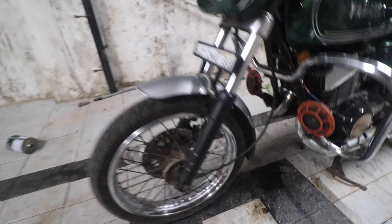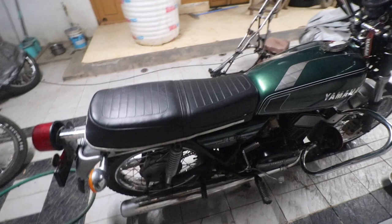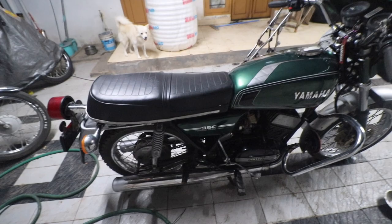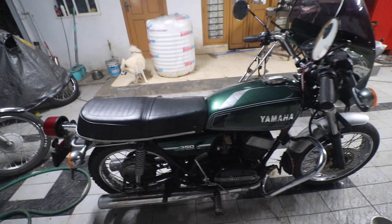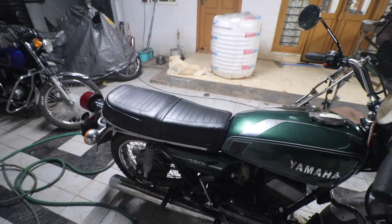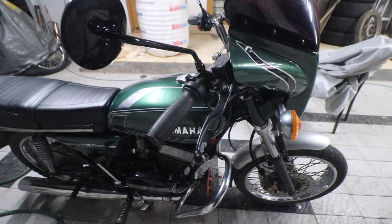Another big challenge with the drums, especially the rears, was the availability of brake shoes. The ones you get these days are made in Delhi and are not the exact shape as what came from the factory — I kept two for comparison and found the shape was not identical. Another challenge is these drums get warped; they're not cylindrical anymore, they're kind of oval. So even if you put a new brake shoe it won't stop, or it might get stuck. It required a lot of calibration to get to where this bike stops amazingly with very balanced brake feel.